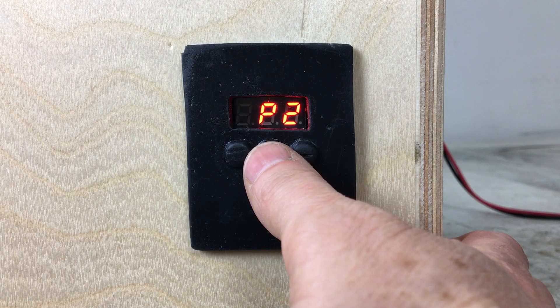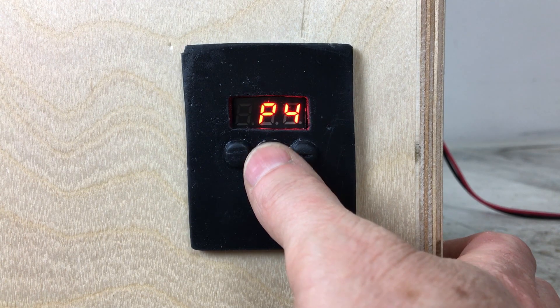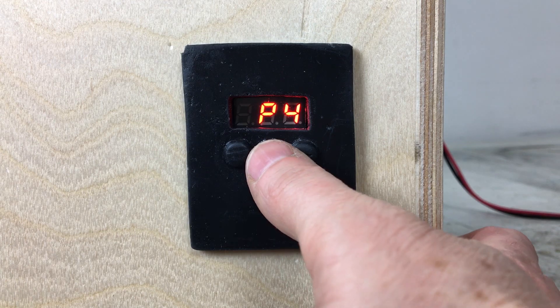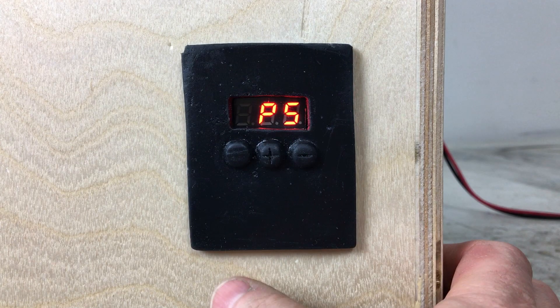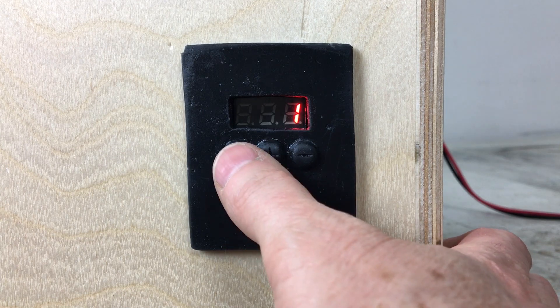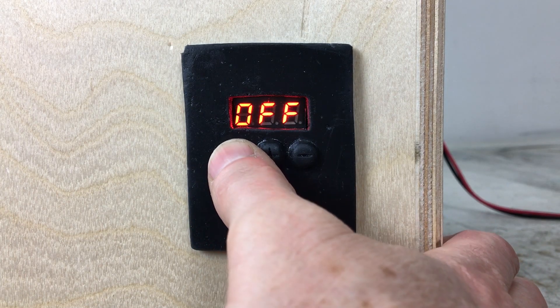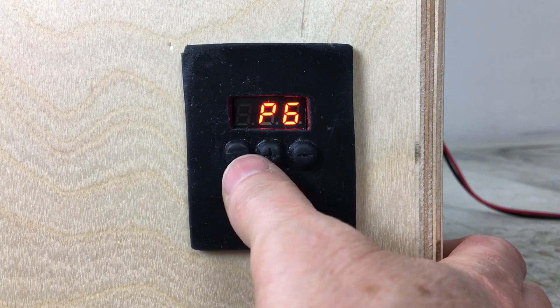The next few parameters you probably won't need. P2 allows you to set a maximum temperature and P3 a minimum temperature beyond which the user can't set the thermostat, but since I'm the only one using it I don't need to lock out any settings. P4 allows you to correct the thermostat for the difference between its readings and the actual temperature — say it switches at 5.1 or 5.2 degrees when you've set it to five, you could set P4 to correct that so it would switch at exactly five Celsius. But I don't need that much precision. P5 is another one that we need — it allows you to set a time in minutes as a delay before the cooler kicks in after getting back above its target temperature. Right now it's set at zero; I'll set it to one minute and push set to confirm. The last one, P6, you also don't need — it's an alarm to tell you if it's over its maximum temperature, and the default is off so you can just leave it. Now we have to wait six seconds and then the thermostat will save the settings.